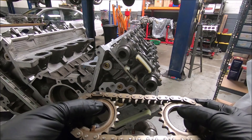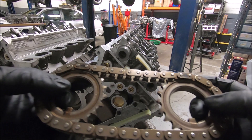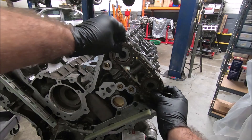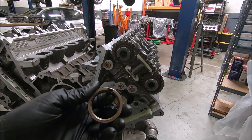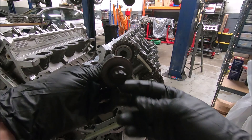You can see there's two dots on the sprockets. I put better dots on these links right here — these chain links were a little darker — so that's how they'll go back on. The intake cam gets a spacer. This also has a cutout for the keyway — it doesn't matter where that's at, you can line it up with the keyway if you want.